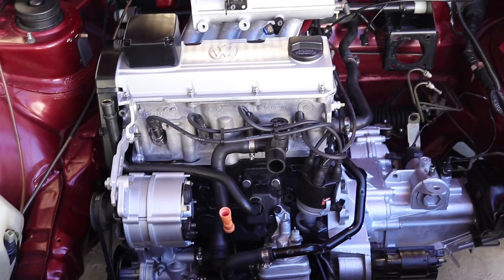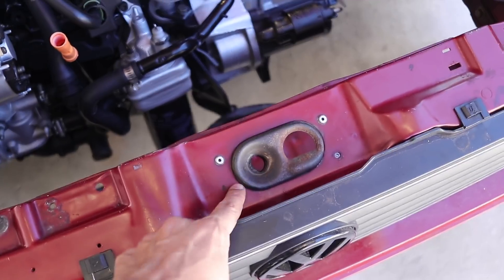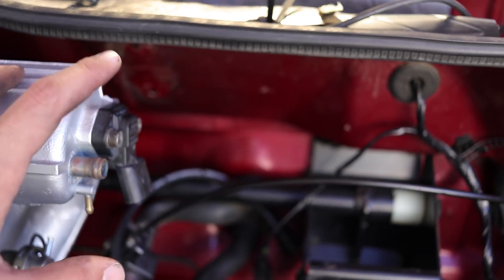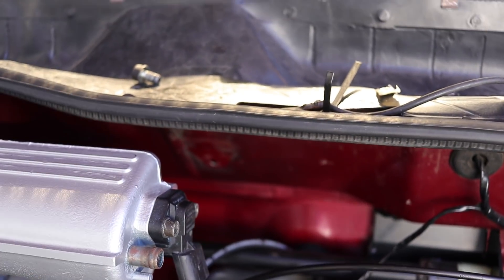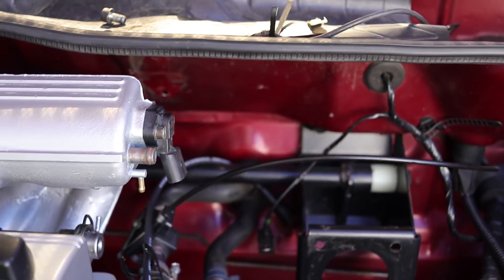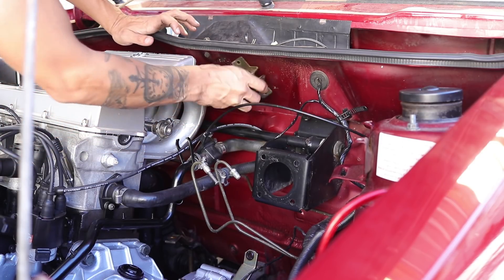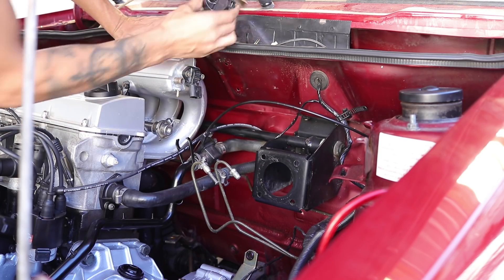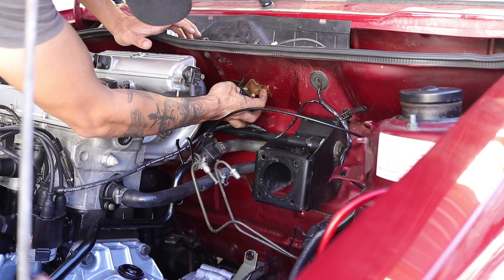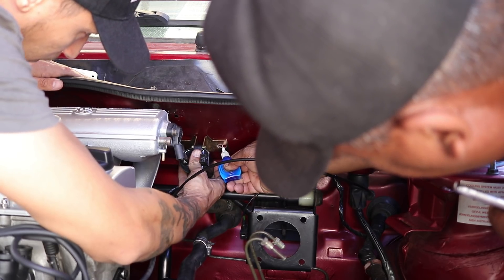What I want to focus on now is getting the radiator in, replacing one of these catches, and getting the brake booster in, and also the coil. We took the coil out because it didn't fit — the intake was hitting against it — so I just want to reposition it so the coil fits in properly. The coil was previously positioned over here and it's touching against the intake, so I'm going to have to relocate it. I'll still use the one existing hole and then add another hole to relocate it.